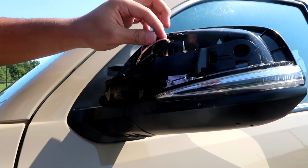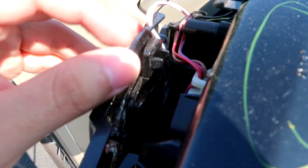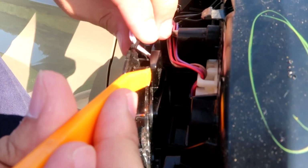There's this little clip here that's not giving you much room to take this out. And there's also this clip right here. So that clip, I take it out first. It's fairly simple. So with the same tool, just to make this easier, you're going to want to pinch down with one hand. And with the other hand, you're going to want to get in between and kind of just get it off of that there. So hold on. You have to show. So like this. So this was in there. You pinch it on one side and you just pop it out the other side like that.